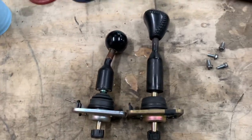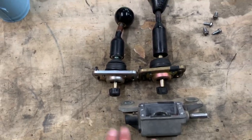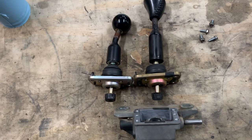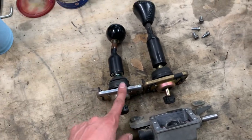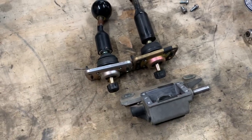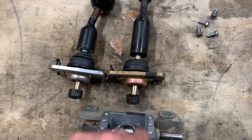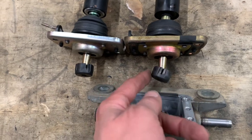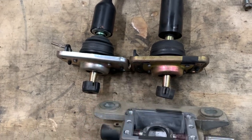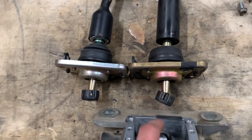They fashioned on a little eight-ball shifter with the proper gearing listed on top. You can see right off the bat how much shorter it is, so it actually ends up working out quite well. The last time I did this for my black car I bought the whole top and bottom unit together — that's just a more expensive way of doing it. This time I'm just replacing the top portion with this unit from TPS. Basically just pull out the four 10 millimeter head bolts. It's got a little bushing on the bottom and when I pulled mine out I can see it's actually fairly worn.